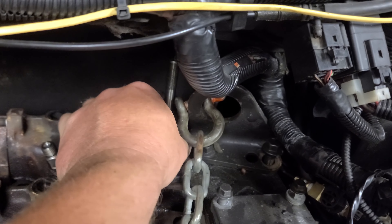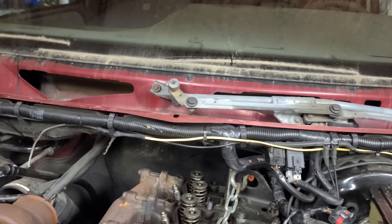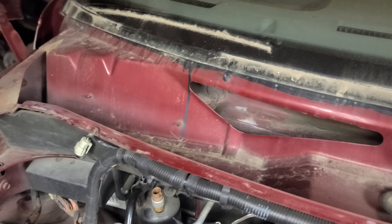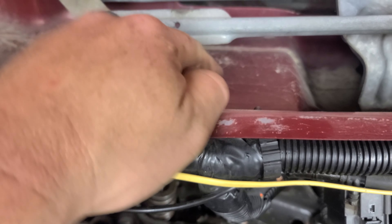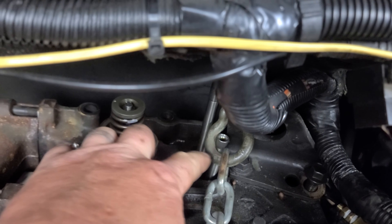I've got one head stud that's stuck and two push rods that are stuck. Now on these second-generation Rams — I think '94 to '98, or maybe even up to 2002 — inside the cowl, where your windshield wipers rest, there's actually a hole there plugged with a rubber plug. It's in just the right spot so you can fish your push rods and that too-long stud through that hole. There's actually another one back there right behind that bar to get the very back one out.